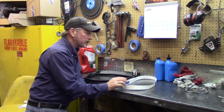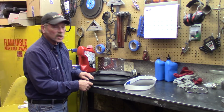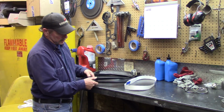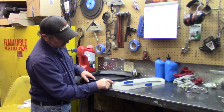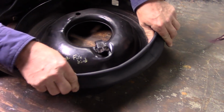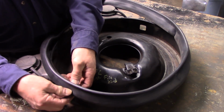After using the modeling clay, we came up with the measurement of the distance that is between the sheet metal and the lid. You can see how this thing's gonna touch it at least, but we want it to seal. So this will fold back when it comes down and hits it. And there's air in here. And you can see the distance. It will get compressed enough where it should seal good. Thinking that this lip clicks on around here. I mean, we're not the right size air cleaner here, but we're gonna have to cut it at the right diameter, but that's the way I think it fit.